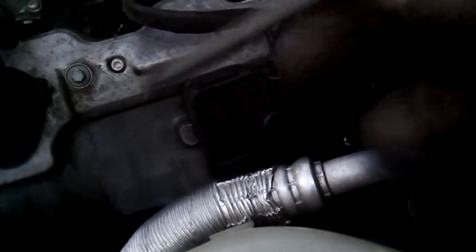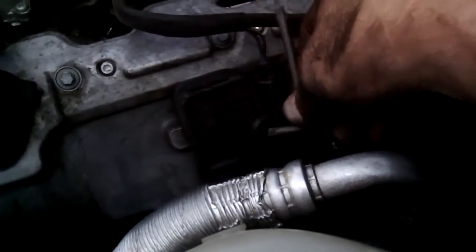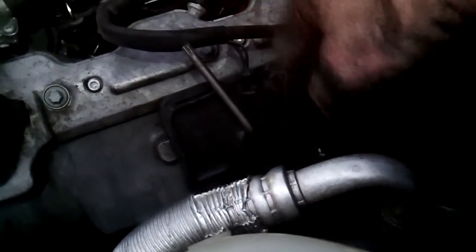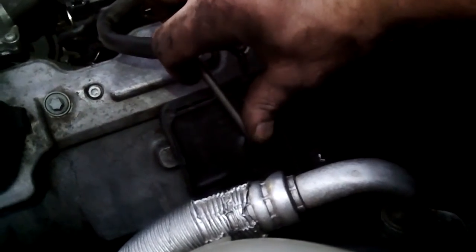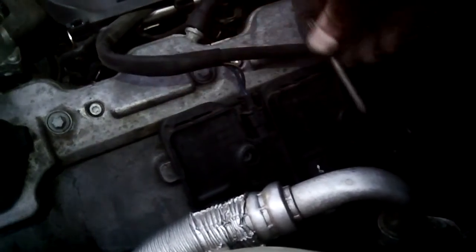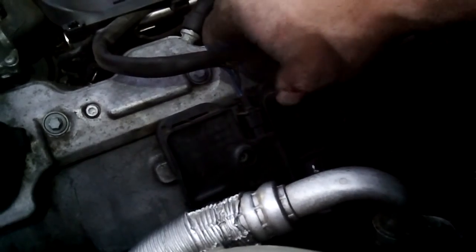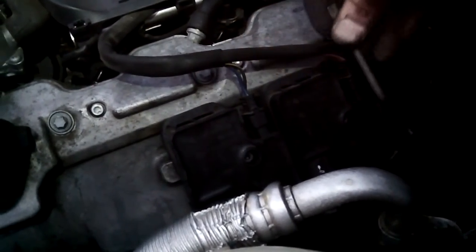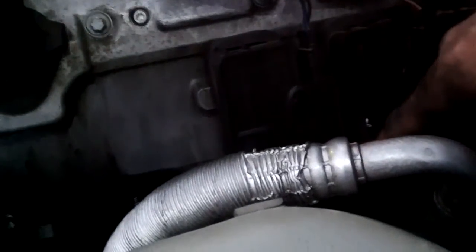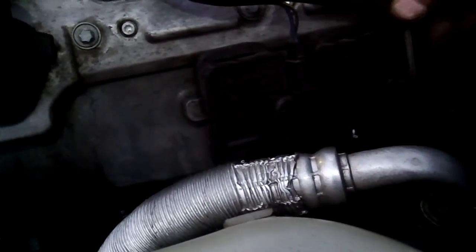Coils going back in — one last thing: I said it was a T25 but it's actually a T30, I had a T30 the whole time. Tighten these coil packs hand tight and then maybe an eighth of a turn after — you're not putting a ton of torque on them, you don't want to crack them, they're like 150 to 200 bucks a piece. All three coils are the same. Make sure you've marked them left and right so you know which plug is which, and make sure to snap the plug boots on properly.